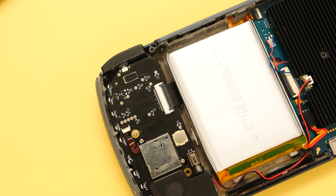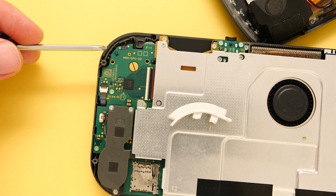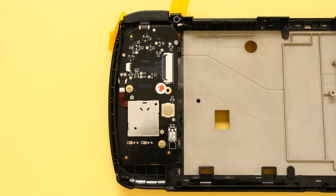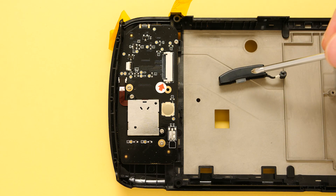Let's talk about the solution that they made. They would continue to use this design for all of the Odin devices going forward, and they would make a separate design that would be used only for a repair kit. With the goal of making a repair kit that is easy to use, they only had a few components that they were willing to change. The best solution that they could ever do would be to modify the front shell and add a guardrail so you would never be able to break the Switch again. On this new design, they made the internal post shorter and they made the rubber piece that goes over it larger.